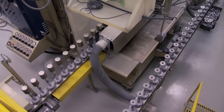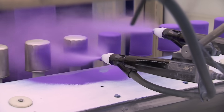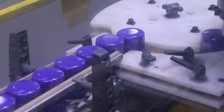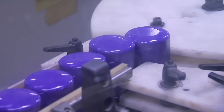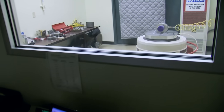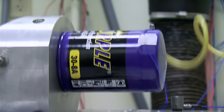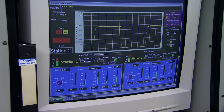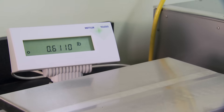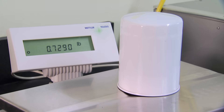Now riding on pedestals, the filters are ready for that trademark color — spinning as the machine sprays on the purple powder coating. Then they're heat treated to 400 degrees, and while still hot, routed to a machine that applies the heavy-duty nitrile rubber-based gasket. Samples from production runs undergo a severe sequence of tests — vibration and shock at 6 Gs to make sure they'll stay together. In this part of the lab, they undergo 150,000 continual start-ups to check for fatigue. Royal Purple filters weigh 40% more than standard filters, thanks in part to a stronger steel backplate.